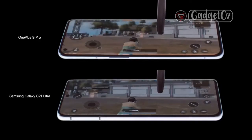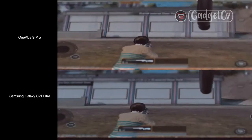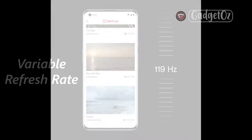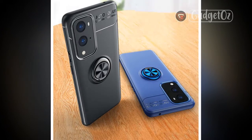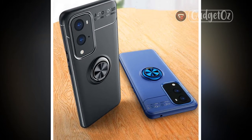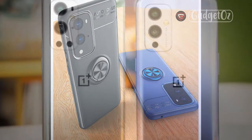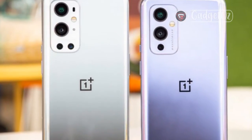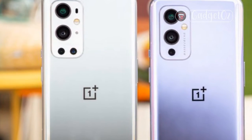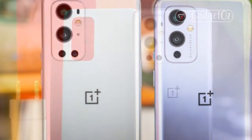system compatible with an included 65W charger, capable of fully replenishing the 9 Pro's battery in just about a half hour, but with improved charging software and lower internal battery resistance, they've been able to provide even faster initial charging from flat. OnePlus is also debuting a faster Warp wireless charger with the 9 Pro that outputs 50W, and we'll be giving that a test as well.